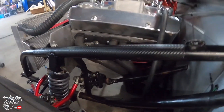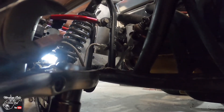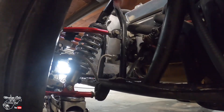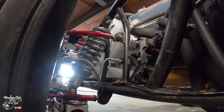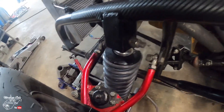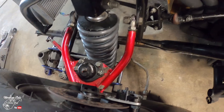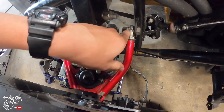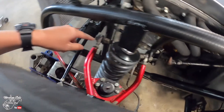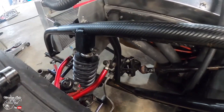He's got some tension on him but I'm breaking this one loose, trying to get a good camera angle. All we need to do — the top of the wheel is in, so we're going to loosen this up. We've loosened the jam nuts on both sides and then we'll turn these probably about three flats each, then do the other side. Hopefully we'll have no more camber issues.